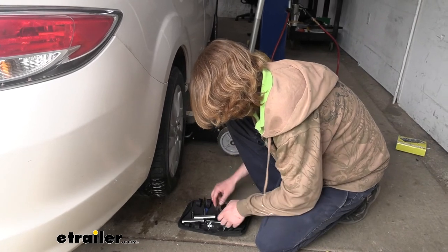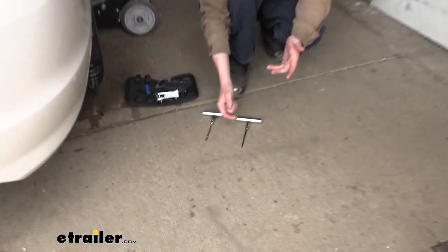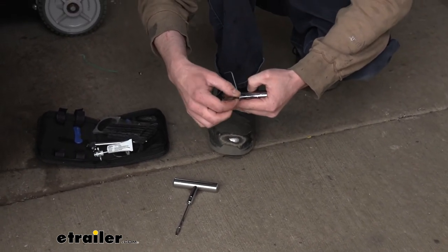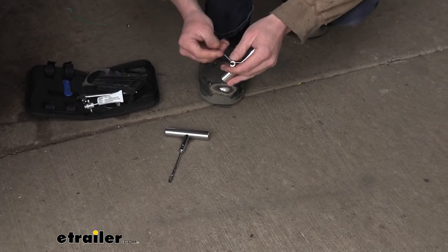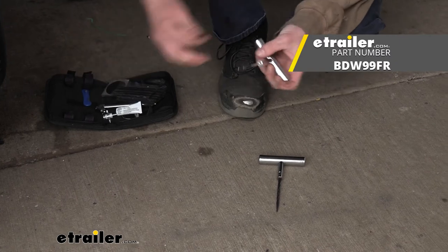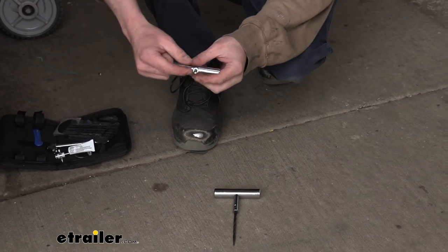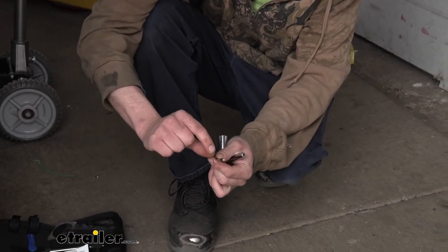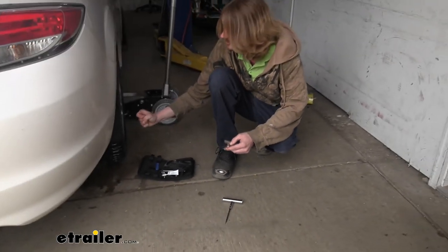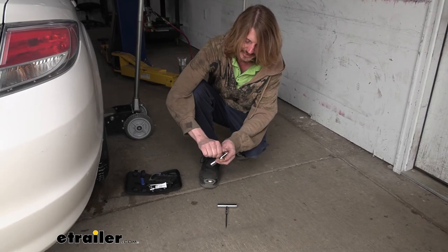The last thing to talk about in this kit is the ends on the tools — they are removable. So if you wanted to upgrade them or if something happened to one, you could replace them. That's what the Allen key in your kit is for — you can loosen and remove the ends and reinsert new ones. Bulldog does have a larger kit that comes with more patches, more plugs, and a few more tools. One of the tools in that larger kit is a second insertion tool with a collar that slides on it — a knuckle protector for when you're inserting the plug and pushing real hard and your hand slams into the tire. That larger kit from Bulldog does come with that protector collar.